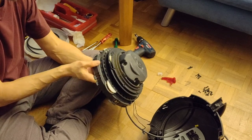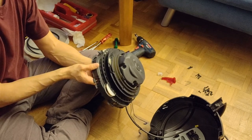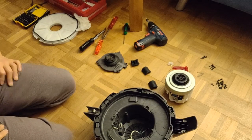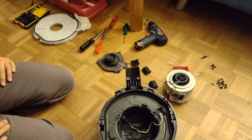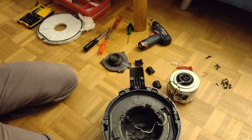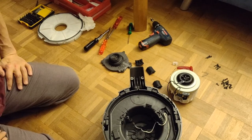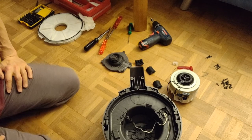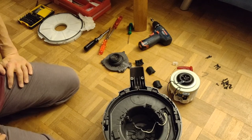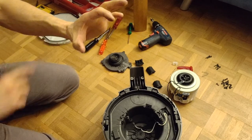Now when I put the cable around it, it will get... So it took me a little bit to figure out how to handle that with the spring. You have to think a little bit. And I have decided to leave the spring almost loose, not so that when the cable is totally inside it can release itself again, as it happened to me before in the video. So I put like 10 centimeters, maybe more, than it is totally released.